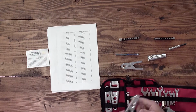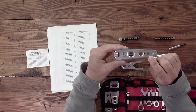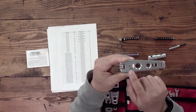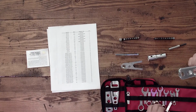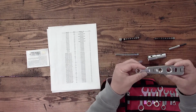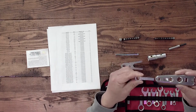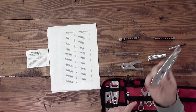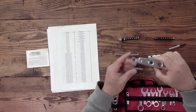I'm going to dive in and just show you how cool this is. So I'm going to take one of these handles here. And inside the handles, there are rare earth magnets. They're small yet extremely powerful magnets. And I'm sure many of you, if not all of you, have dealt with rare earth magnets. What you do is take one of these wrenches. We'll take a closed 10mm here. And it fits on the smaller side of this wrench. And it'll only go one way. I don't know if you can see here. Let me find the camera. There's a small notch in it. So it goes in there, and then the magnet grabs onto it, so now it's in place. It's not going to shake out, okay? And you've now got your 10mm wrench.